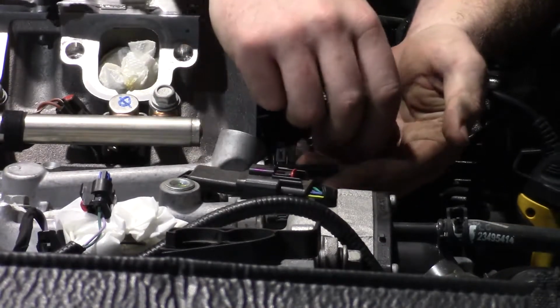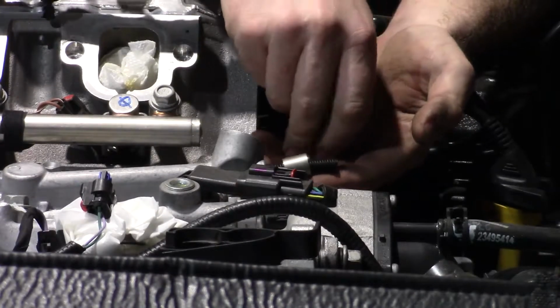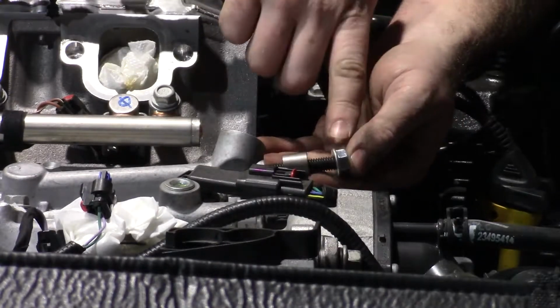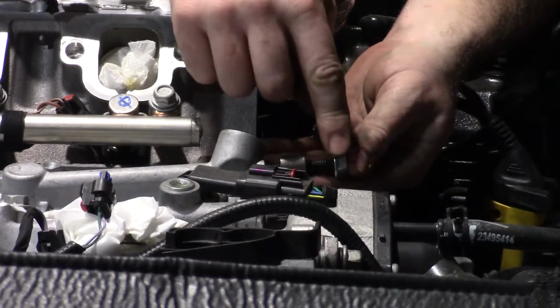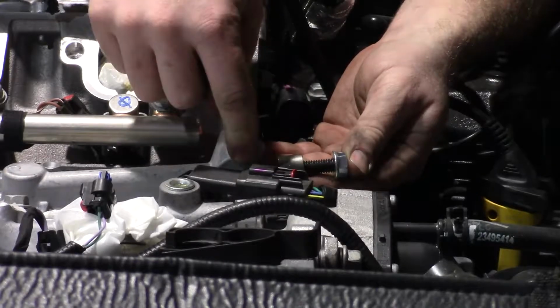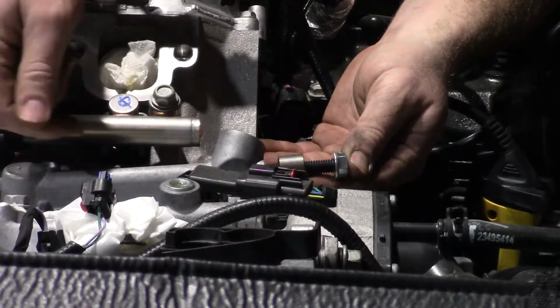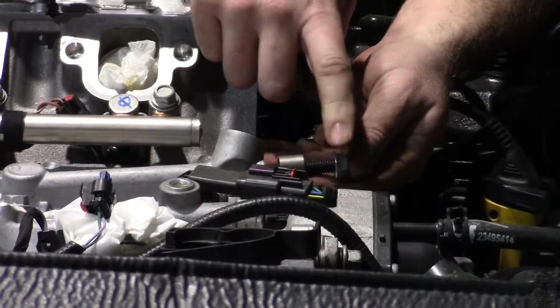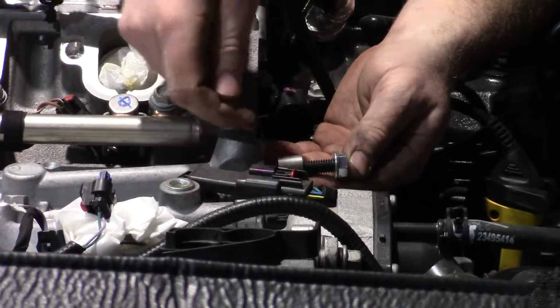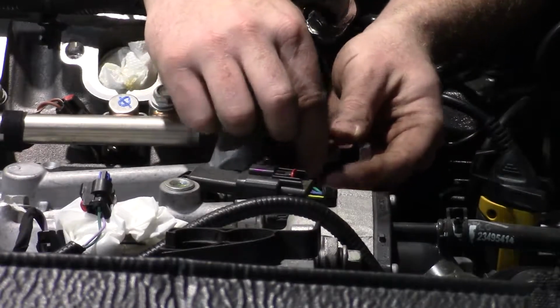Once it's jammed in, we're going to put this little spacer right here on, and then we're gonna put this nut, and we're gonna tighten up the nut by finger, start heating this up with a heat gun so that it warms up the Loctite that's holding that little spacer in, and we're gonna drive that spacer out using this bolt, or this nut I mean. It's gonna pull against, and it's gonna pull that thing right out of there. So let's go ahead and get this done.